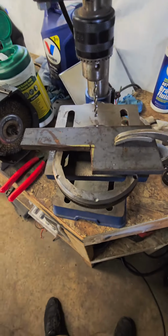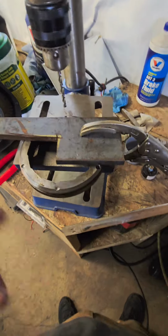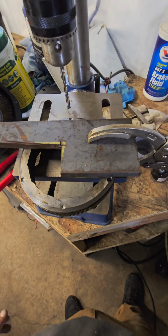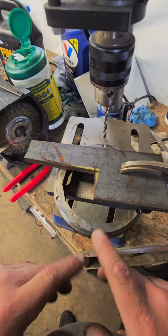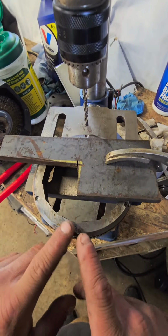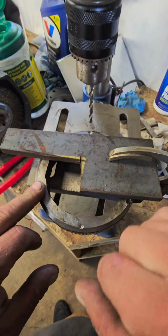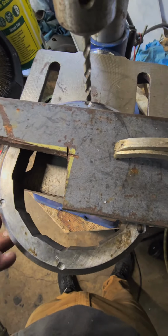So continuing on with this Stage 2 1,000 horsepower 46, 47, 48 RE build, I'm just getting the bolt-in Sprag out of the way right off the bat, because that's one of the most time-consuming parts to do, and you're gonna want to do it. So, like I was saying, if you have a sharp drill bit, you're gonna drill through the case with your A&A jig, and then you're gonna want to drill into the case and then into the Sprag race just a little bit, so you leave some dimples. The dimples are there so you can pilot your drill press.